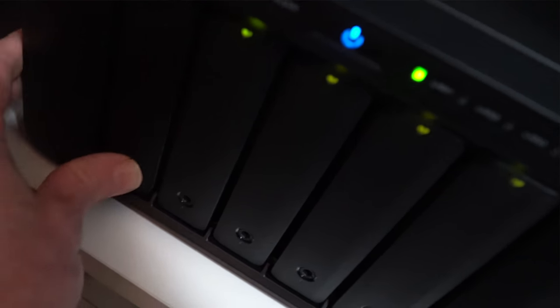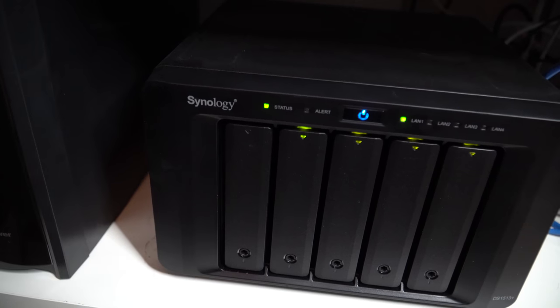We ran integrity tests before that — very important. Then to expand the drive, I use Synology Hybrid RAID. The big thing to know is that it does take some time to expand that drive. For me it took about 36 hours to expand the volume, but once that happened I ended up getting roughly eight terabytes of extra storage. I'm going to take the one I just got yesterday from Best Buy.